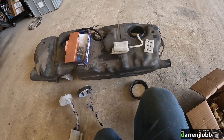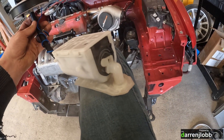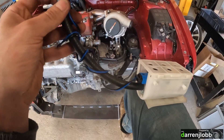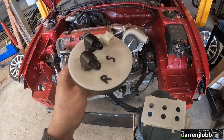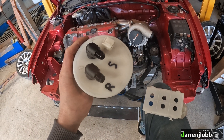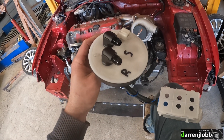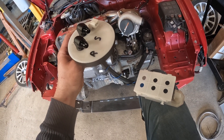That's all put together - the fuel pump fits in there nicely, the original sock fits on, and we've got the modified top. I've just got to put a short bit of hose on the return so it drops down into the tank a bit. Original wiring, original connector - all plug and play. A useful tip: make sure you mark your send and return lines now, because when you put it all together it saves a whole load of hassle when you can't remember which is the send and which is the return. In this case we're using the same size fuel line for both, but using different sizes is a common way to differentiate them. That is now ready to drop in the tank and refit back on the car.